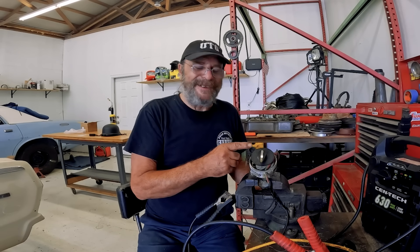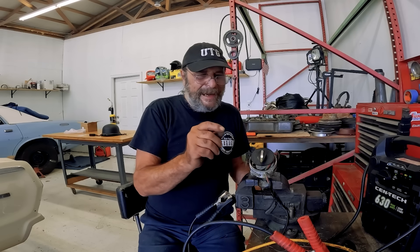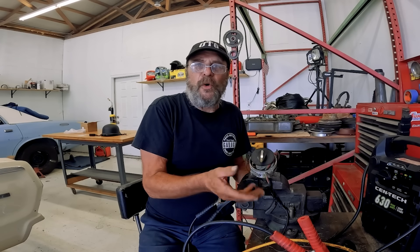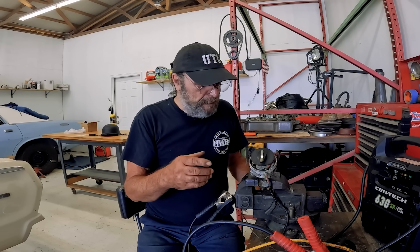Success — I think we did good here. I wasn't expecting it to work that well, but it did. Now I just have to clean this distributor up and drop it in. I'm probably not going to use that coil — it works fine, but when I pulled the wire away from the ground I got maybe half an inch before the spark became erratic, which is indicative of a low-performance coil. With a high-output coil I should be able to go three-quarters to almost an inch away. That's what I'd get with one of those big yellow coils. Any high-performance coil will give a similar result.